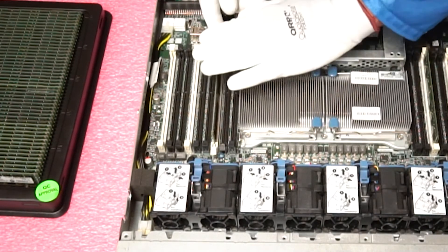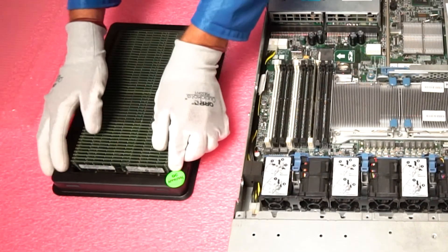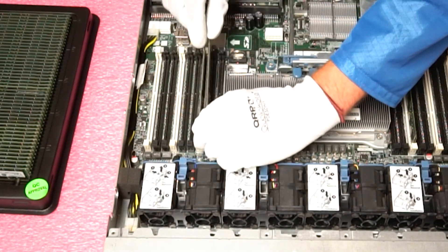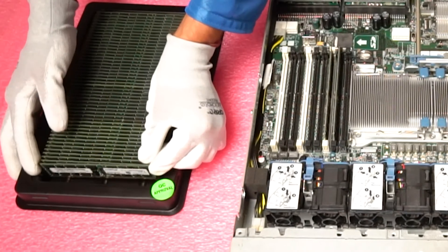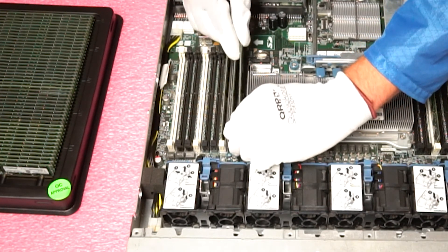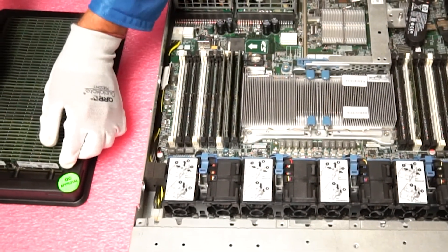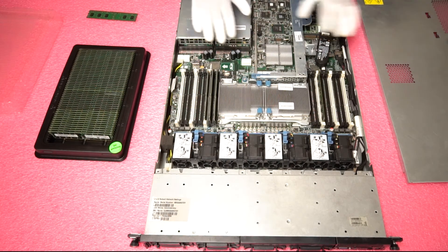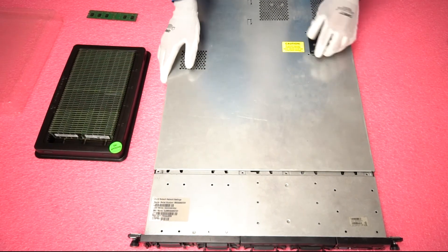This is all very simple. You need to push down hard enough to make sure the clip goes in, but gentle enough that you are not damaging the machine — use force as appropriate. We're going to fill this channel up. The cool thing is you can really load a machine up in a matter of minutes and boost your performance. With as cheap as DDR3 memory has gotten, for a couple hundred bucks you can do a lot to increase overall performance. Once the configuration is filled, just put the top back on and close the latch.